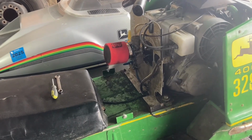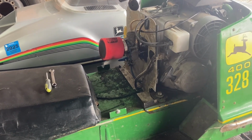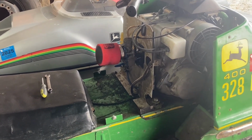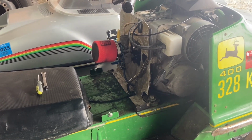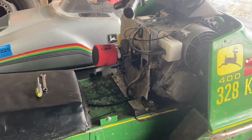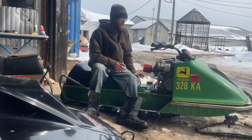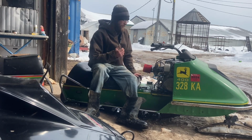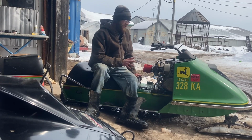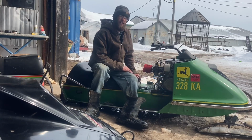The P4 really helped out in the mid-range, but it also screwed up our main jet selection. Mostly because the main jet is also metered through the needle jet, and now I gotta play around with it some more. I feel a bit like I'm chasing my own tail here now, so I think I covered all of the main adjustment points, the pilot, needle, and main jet. So I'll just continue fine-tuning, not recording. I'll get back here with what I find works best.